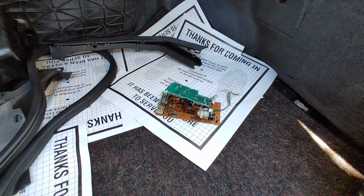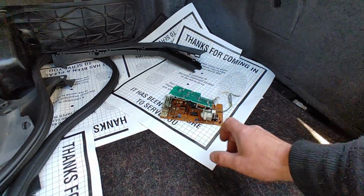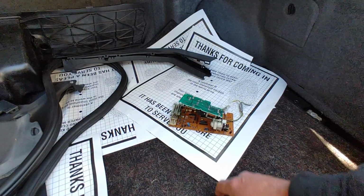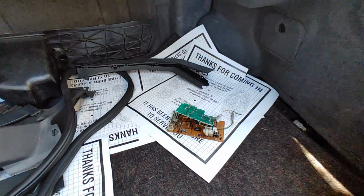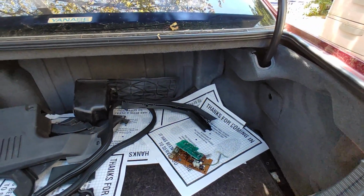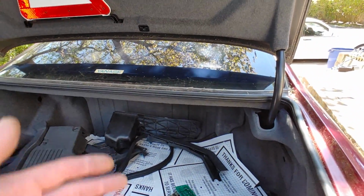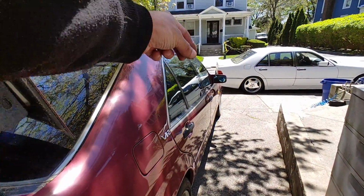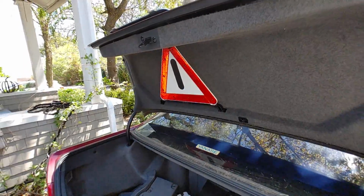So I had some pumps laying around, so I found a board that's similar, and I had to transplant the top portion from the original pump, and I actually had to delete this anti-theft system because my pump did not have this pin. I don't know, it's like a weird hybrid kind of situation, but nonetheless it works now. Door locks work because that's the first thing that you want. Can't really have this car to open and close door locks by hand. It's just really annoying. Each and every door you have to do. This is just too bad. So that was first order of business.